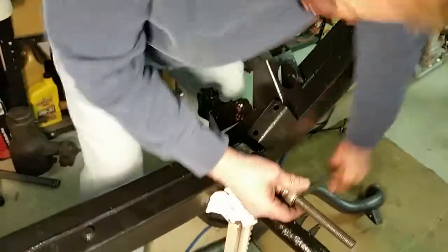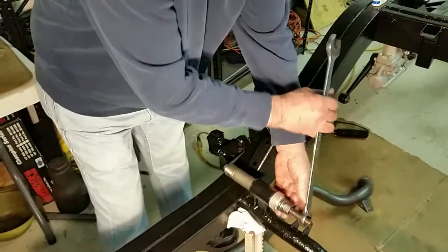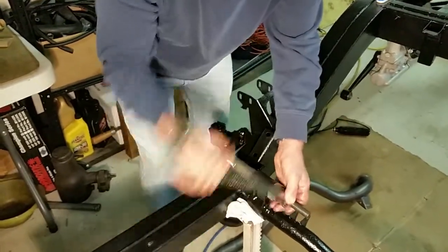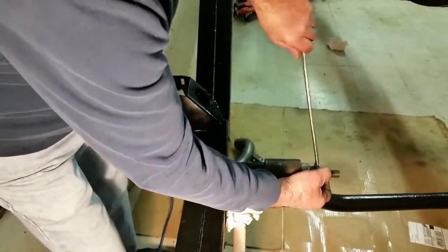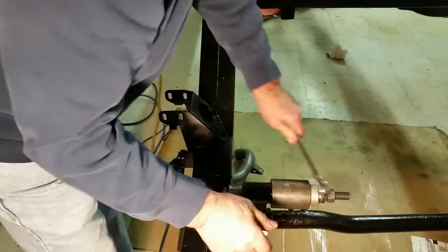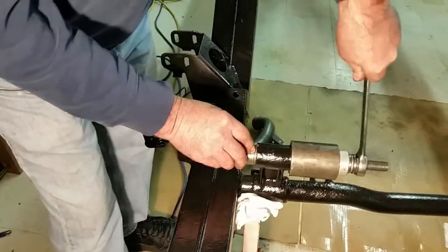It's stopped and it's still sticking out there. I have to use the spacer part of the tool to centralise the bushing. We're just going to take it in a little bit more to centralise it properly. You can see we've got an equidistant bush — we're just going to use the spacer part to bring this area here so it's centralised in the chassis leg.